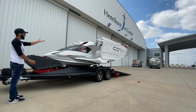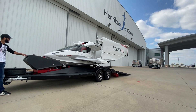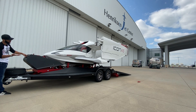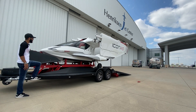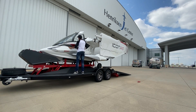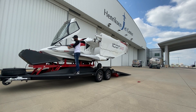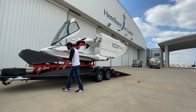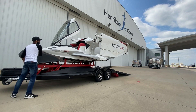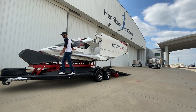We're pretty much on the trailer. We just need to do a couple more things: we're going to raise the whole airplane, retract the landing gear, then drop it — it's going to sit even lower. I'm going to push this button, the bunks are going to come up. It's up. Now I'm going to retract the landing gear — I've got to turn the plane on (not the engine, just the plane). Verify the gears down, turn the master switch on, pull the gear up — it's going up, both sides clear. Turn the master off and then go down.